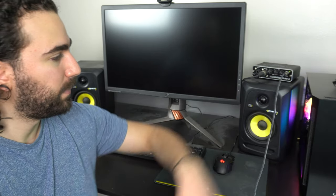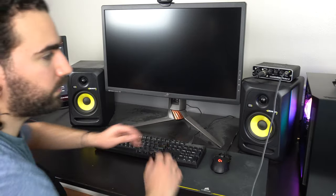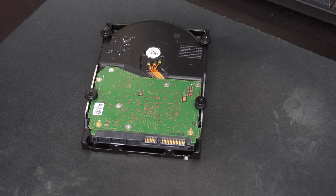I just plugged in my PC. I haven't turned it on yet — turning it on now. I don't feel it spinning. That's not good. It does not look like it works unfortunately. I have the BIOS open on the other screen and the drive is not detected. So it's probably that 3.3 volt SATA pin I was mentioning earlier. I'm probably going to have to take off the drive and block it off somehow. The system won't recognize the drive and I can't even feel it spinning up at all, so that does seem to be the issue.